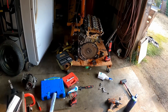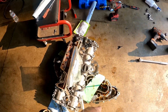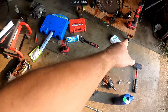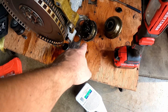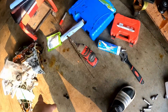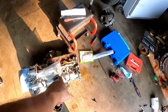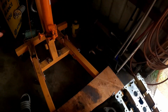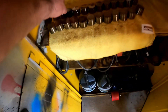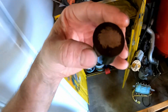I'm kind of rushing today to get the engine apart. You remove the outer cover, inner cover — you need to get the exhaust and intake hubs off to get the inner cover off. Once you get the inner cover off, then you're able to take the valve cover off, which I got. And then I organized the tappets here. On the exhaust side, tappet number three is really burnt.